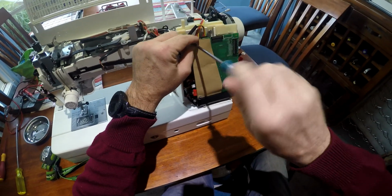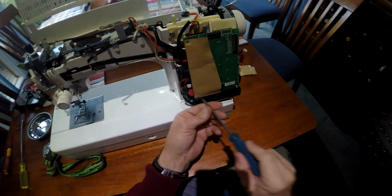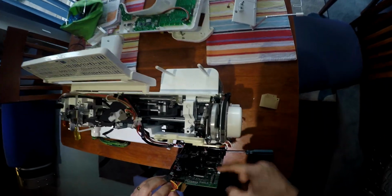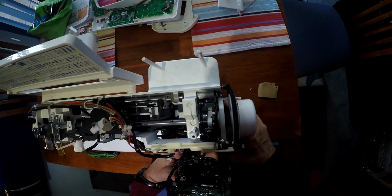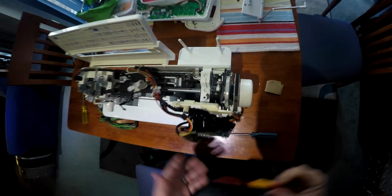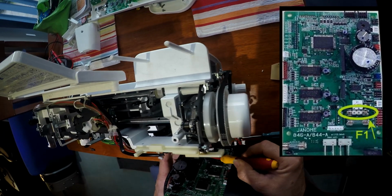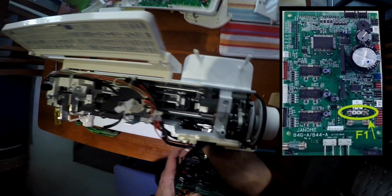This is the main power supply board, I think, so it has these protective cardboard sheets. Now if we look down on the inside of this board, there's one connector here. You need to really pop that one off, although you can get it. No, probably do it. Okay, so there are 3 fuses in here. F1, F2 and F3 is behind here, but this is the main one we're interested in, so we're just going to carefully pop that fuse out.